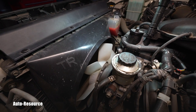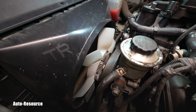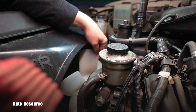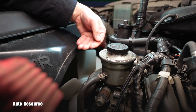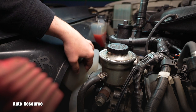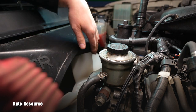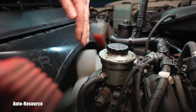I'd like to show you how you can tell that the clutch is too weak — it's not giving enough resistance when I try to spin it. When the vehicle's engine is off, all you have to do is observe safety. Don't do it when the engine is running; don't try to grab the fan — it might chop your fingers off depending on how good the clutch is. I'll try to spin it: it should give resistance against spinning, but this one starts moving freely and rotating around. It's not the worst I've ever seen, but it's on the way out.